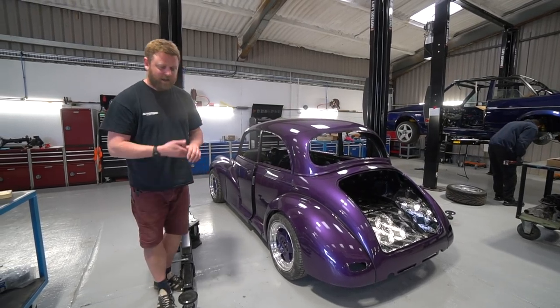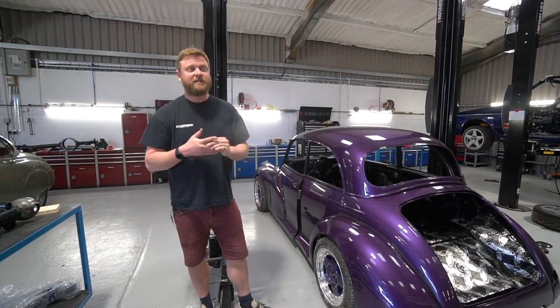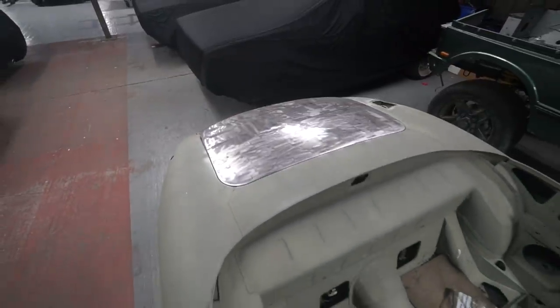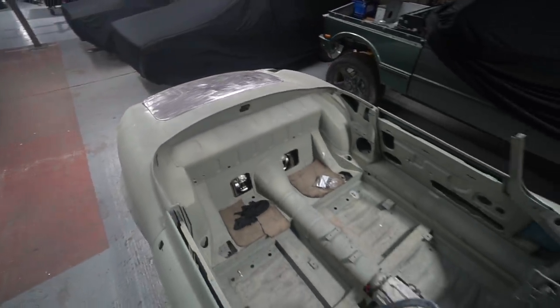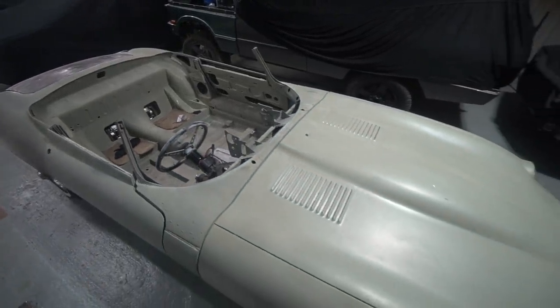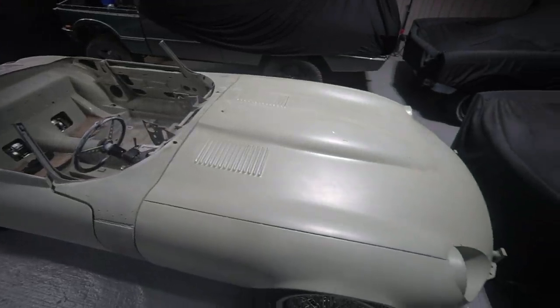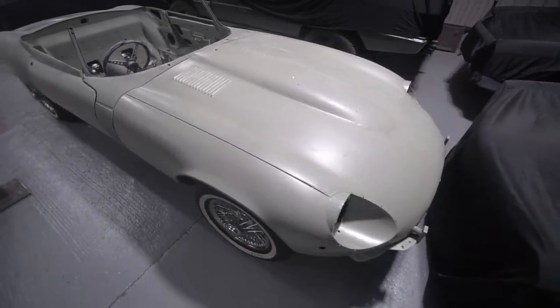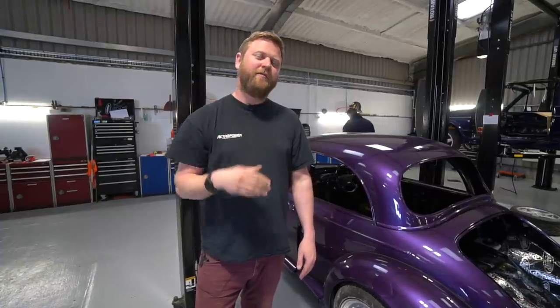The E-Type in the background — George has been working on more of the exterior design on the E-Type. The rear end we'd done a lot of work on; the front end is what we've been concentrating on over the last week — changing the details of the shape to get it to where we and the owner want it. The biggest part is the flare. One of the bigger changes on the Series 3 is that the arch was much higher up the body, which necessitates quite a pronounced flare above the arch. As you play with the design in 3D CAD you realise why — if you look at the side profile, it's a quite curved-out shape, and if the top of the arch gets above the apex of that curve it starts to cut into the body line when viewed from above.